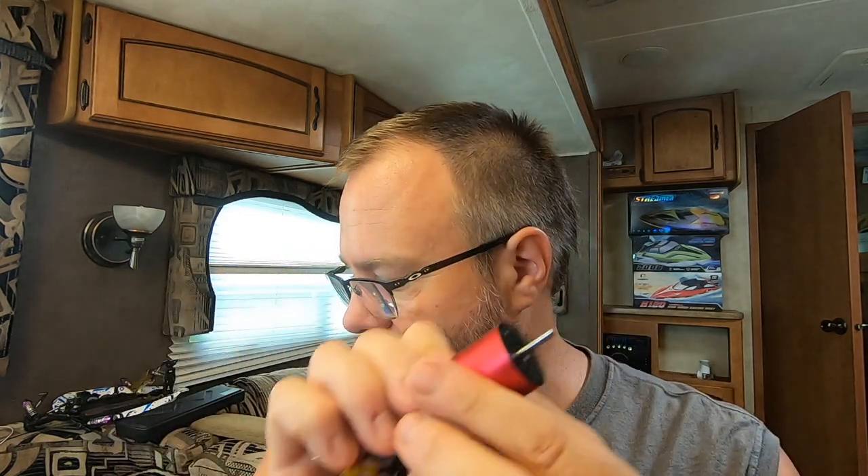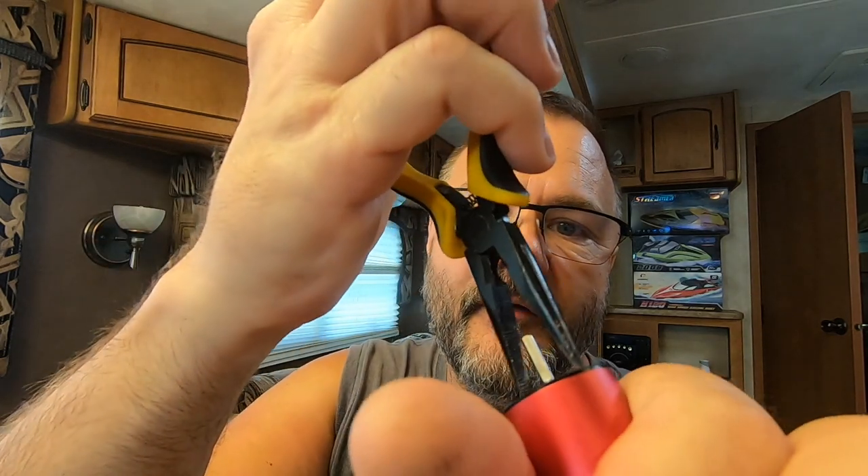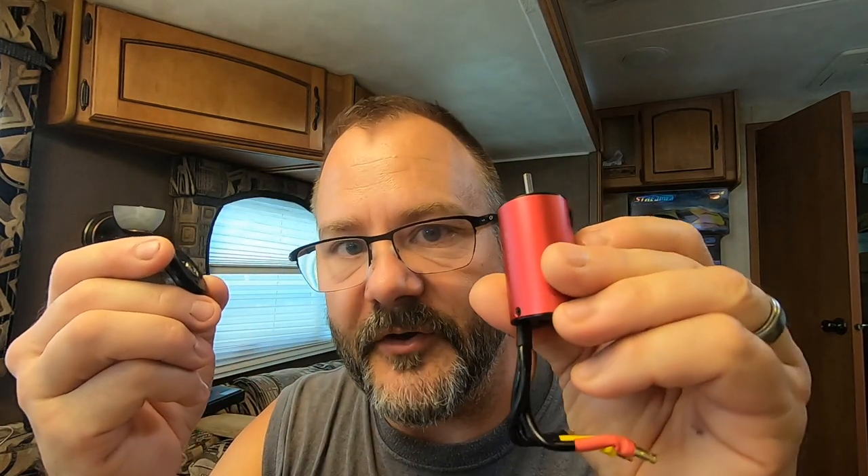These two holes line up, so it would place the motor in the same location. I could still use the factory motor mount with the factory pinion, provided I can unscrew this cover. With possibly a little heat - it might be loctited - then use needle nose pliers like a spanner wrench to untwist this and twist on the 2300KV motor cover.